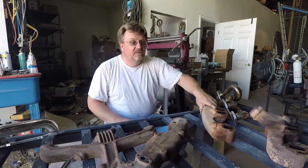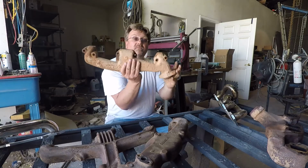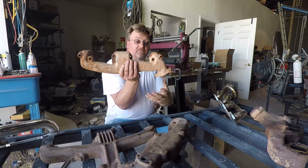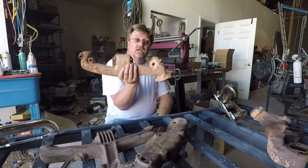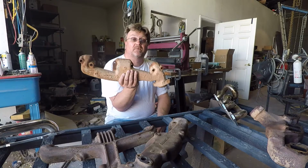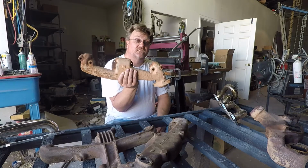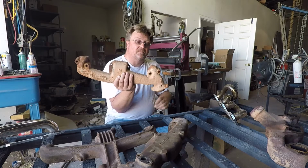Next thing I have is the transmission came out of a Dakota. The Dakota manifold would fit the transmission. It puts the starter right here, the exhaust goes behind the starter, and theoretically it would work fine with that motor tranny combo. Problem is, it won't work with the ZJ, because the ZJ has a firewall there, and that's going to be a problem.